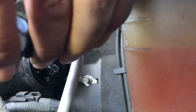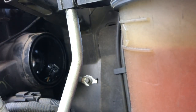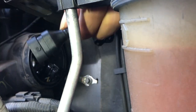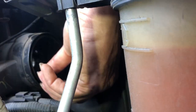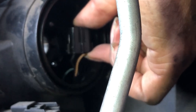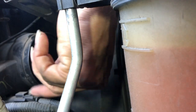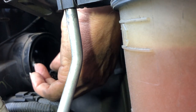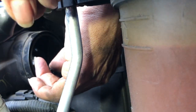It's got to unhook from this little tab — the thing hooks over this and hooks along this ridge. The new one has a tab and a ridge so it sets the same way, and it's on both sides. They show you a positive and negative: the black side is negative. One side is black and one is white or yellow. You want to line the black wire with the negative hole — black to negative on the same side.